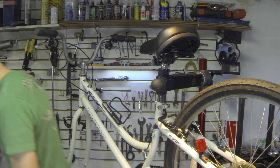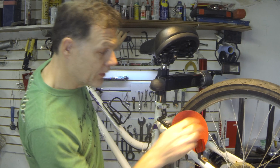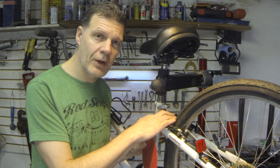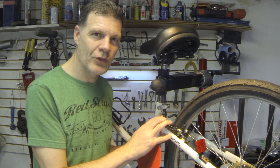Sometimes when it's making a lot of noise and it's hard to get them set up properly, the brakes are just glazed or the surface of the pad is contaminated. If you put a bit of coarse sandpaper in there, squeeze the brake slightly, and rub it, you can actually polish the surface of the pad and make it nice, parallel, and fresh — and I find that'll take care of the noise a lot of the time. So these are just a couple of tips — things to think about when you have V-brakes on your bike. If you have any questions, leave them in the comments, and maybe I'll dive deeper into different kinds of brakes in future videos. Thanks a lot for watching, take care.